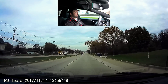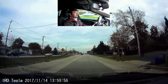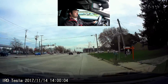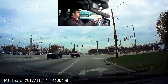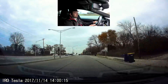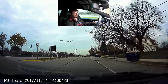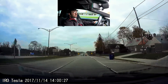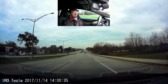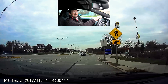Not warming up the battery pack not only gives you slower charging or no charging at all or no regen at all — you might also have lower power output when driving. If you watched my video about plugging in with an absolutely frozen battery pack, you can see on my energy graph I was limited to about 75 kilowatt of acceleration. Drawing a lot of power at colder temperatures also means a lot more resistance in the batteries, which will prevent you from efficiently drawing a lot of power. That's why Tesla limits the output, and that limit also reduces the amount of stress placed on those cells.